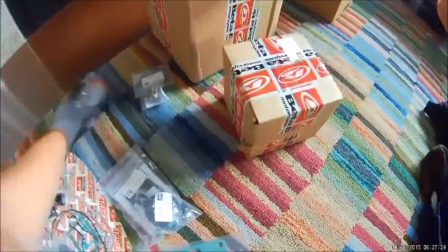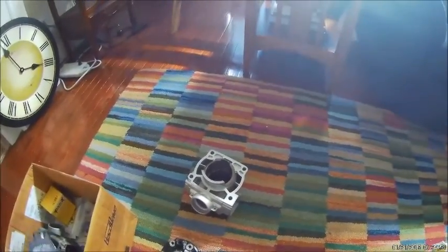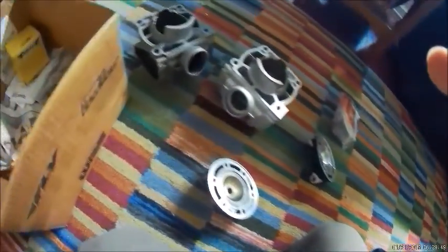New reeds, new head — but I got the head repaired so I don't need that. Brand new crankshaft. And here is the brand new cylinder — or the replated cylinder. Here's the old jug. I don't know if you can see the scratches — there were score marks. So there's a brand new piston by Pro-X.